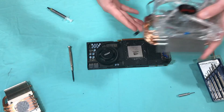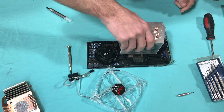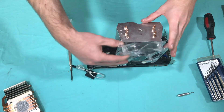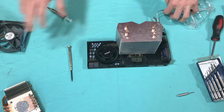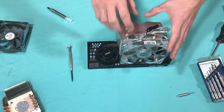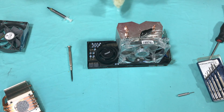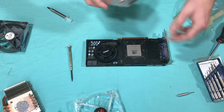Let's lay the card down and get this going. First, figure out where you want the cooler centered. Make sure it's all positioned where you want it. I'm using a case fan because the stock cooler only supports 3-pin, not 4-pin — plus this one is an LED blue fan which looks cool. It'll plug into the motherboard. Now bring out the zip ties — these are going to hold the cooler down. Just be careful not to put it on the wrong way.